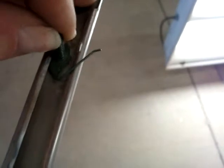All right, we're putting this molding on, and you can see I've taken these old clips off. They were just too bad. The spring boxes were broken off of them, so I have some new clips here. Putting those in, and I don't know if I can hold this camera and show you about this. Get some light on this. See, I got the clip in here. You just take that clip, you drop it in place, you turn it where it needs to be like that, and you raise this spring wire up, and you clip it down underneath the edge of the trim like that. That's what keeps it from sliding back and forth and holds it in place.